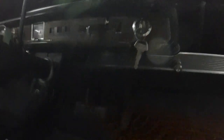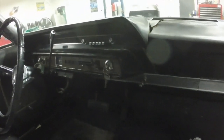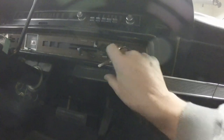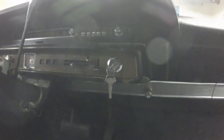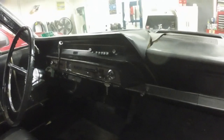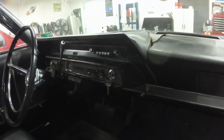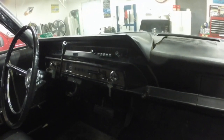The neutral start switch was bad, so I got a new one and put it in. Then I could get intermittent power at the solenoid. When you'd turn the key to start, the light most of the time wouldn't come on. So I wiggled all the wiring under the dash. First I thought it was the new neutral start switch because it was intermittent, so I wiggled all the switch and stuff — that made no difference. I took the switch out and saw there were a couple little light ball bearings that made the contact. So I found a couple carburetor check balls and fixed the original neutral safety switch, put it in, and it did the same exact thing.